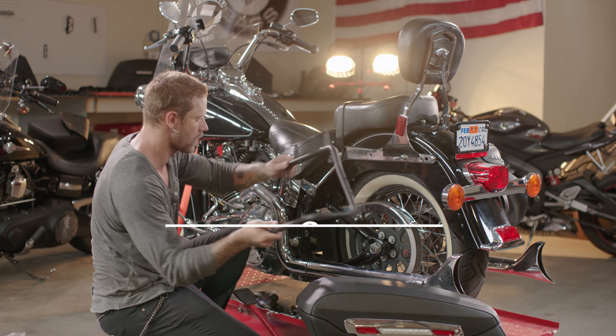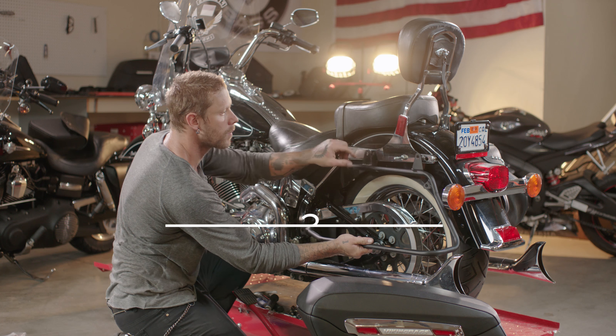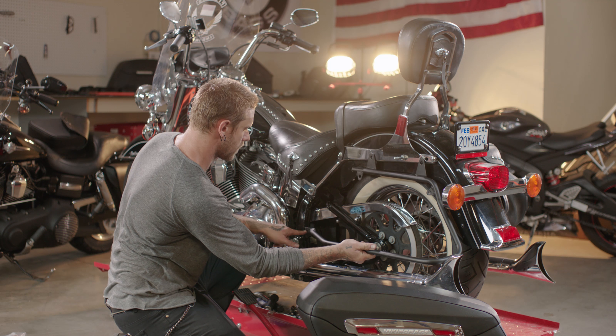You may replace the OEM Harley fender bolt into the middle bolt hole in the fender. Next, place the mounting brackets so the top two holes in the bracket align with the two holes in the rear fender and the front hole in the bracket aligns with the passenger foot peg slot.